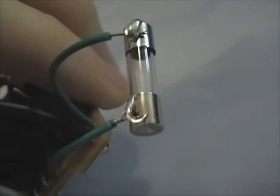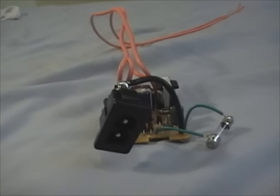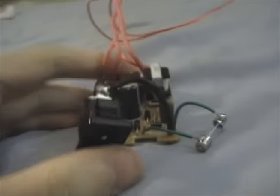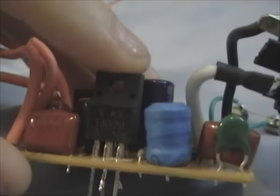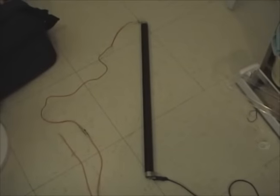I didn't have a fuse of the right size so I soldered some wires where the old fuse was and soldered them right onto the new fuse. The old fuse was rated for 1.5 amps, this one's rated for 0.5 amps - under normal use this thing should draw less than a quarter of an amp, so it should be fine. I'm going to strip the appropriate wires, use alligator leads to connect them to the original 17-watt lamp, plug it in, and use a surge protector with a switch to turn it on. This is the very first low-level repair I've ever done on a 120-volt device so I am kind of nervous. I also had quite a bit of trouble soldering the new transistor - got the iron blistering hot - so hopefully I didn't damage the transistor with heat.